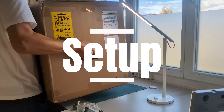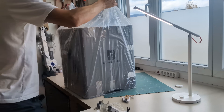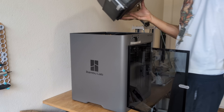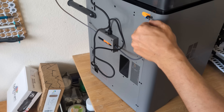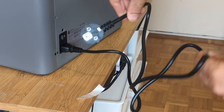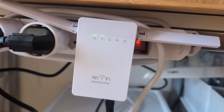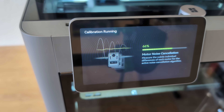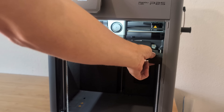Everything arrived at my home after only three days. It came well packaged with the AMS securely screwed into the printer. All I had to do was unpack it, loosen the screws marked with red rings, remove the AMS, attach the display, and insert the tubes to the AMS — and there are a lot of tubes to insert. Then plug in the power cable, which is way too short at one meter. There's also no ethernet port so you have to use Wi-Fi. The automatic setup takes about 30 minutes while the printer calibrates itself.